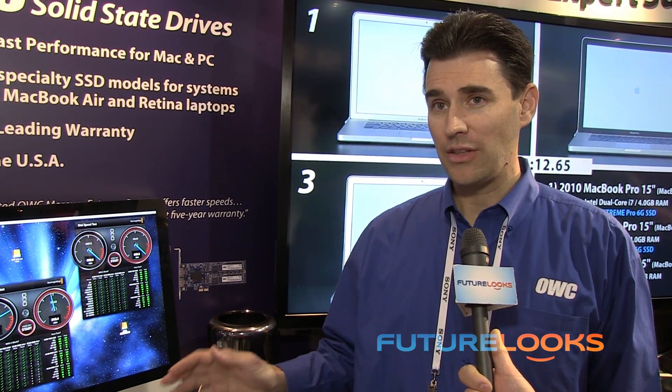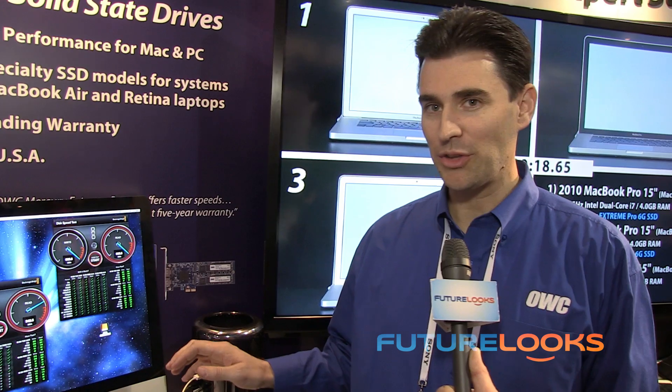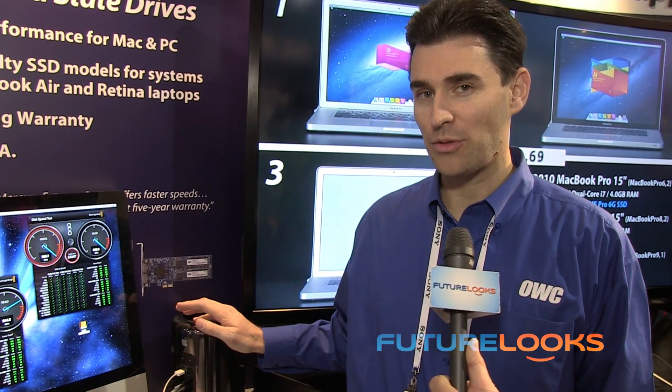There's a little bit faster processor out there. This is something a DIY guy, if you're comfortable taking something apart — and we've got a video up that shows how it all comes together — but it's not necessarily for the faint of heart. We don't recommend going above Apple's maximum processor wattage of 130 watts. We have confirmed now that all the Xeons in the 1600 and 2600 line are pin compatible and plug-and-play functional with this system. This machine is very friendly when it comes to processor upgrades.